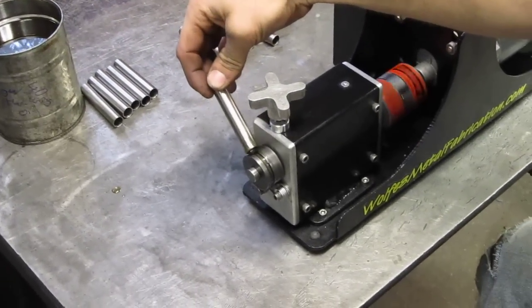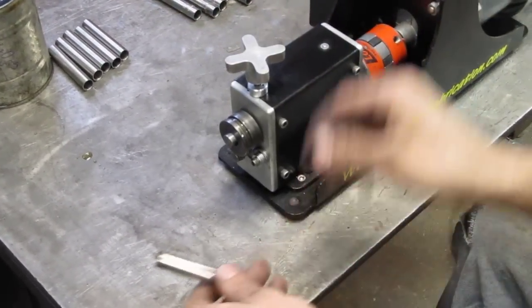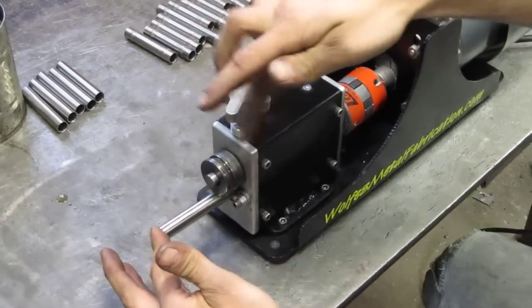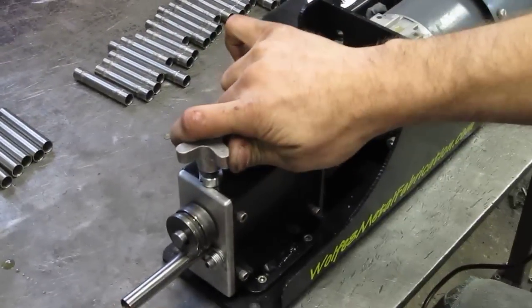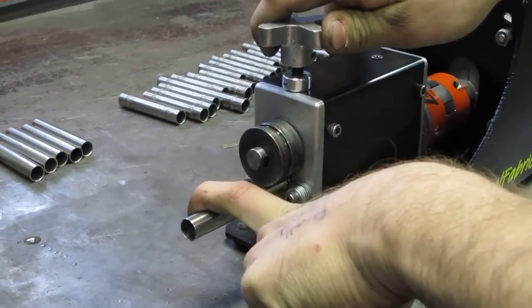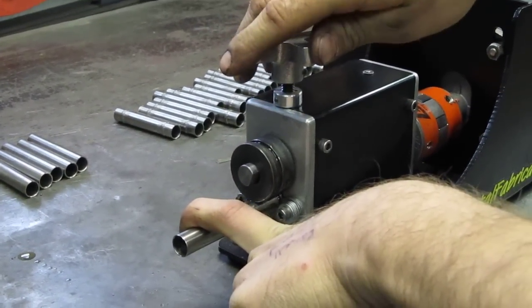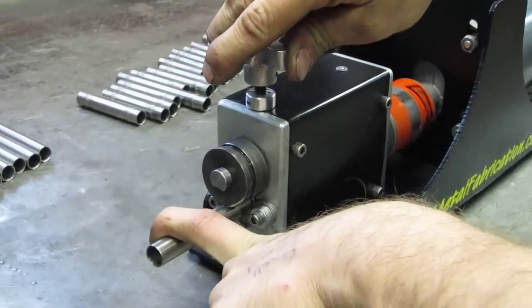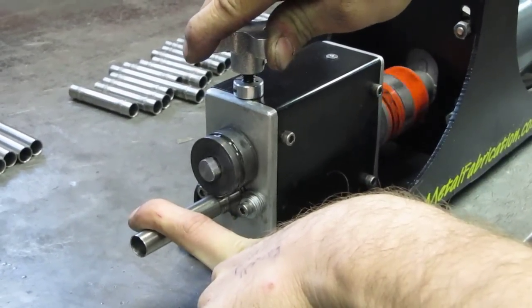I'll lubricate the rollers real good in here first. Basically stick your tube on there, tighten up the tension all the way, and then put slight pressure on it towards you to keep the tube from walking off the shaft. If you don't, you'll see what I'm talking about sometime. Then you just push the pedal and she'll start forming the bead. I usually put a little pressure on the tension knob to make sure she's going all the way and then run it just a little bit to make sure it makes the bead nice and smooth.